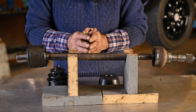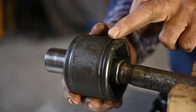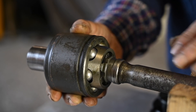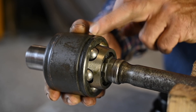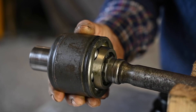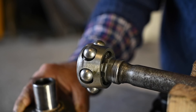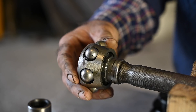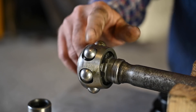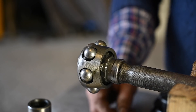Let's go ahead and disassemble the inner CV joint. This is the pot that fits into the differential and you can just slide that off. If you remove the drive shaft from the engine make sure that this stays inside the differential — you can always pry it out afterwards with a big screwdriver because you can't get this through the hole in the subframe. So let me remove this and then we can have a closer look at the inner CV joint itself. It's nothing really special — a couple of big metal balls rotating inside a track and a race that holds it in place.